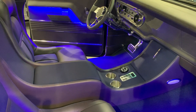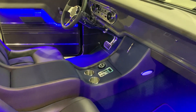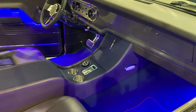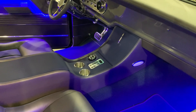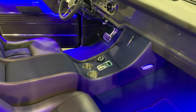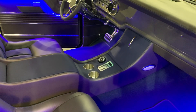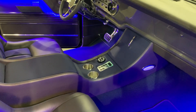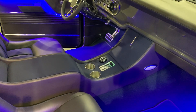I love the way that console — the two circles — it almost looks like the back end of a Falcon, doesn't it? Yeah, and if you look in the center there's a round gauge — that's our turbo controls. We can raise and lower the turbo boost with that. Next to it is the shifter. Powertrain Control Solutions builds a transmission controller for the 4R70W transmission — we used their controller and interfaced it with their push-button shifter. Oh, that is really something, John.